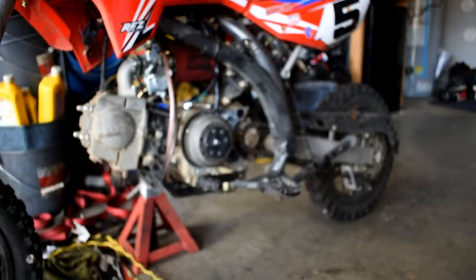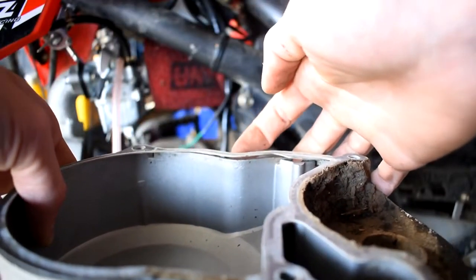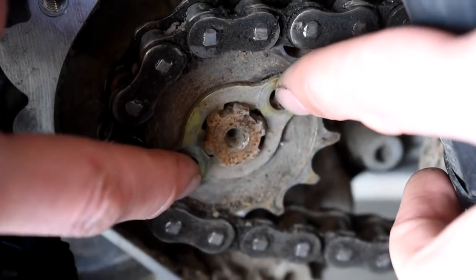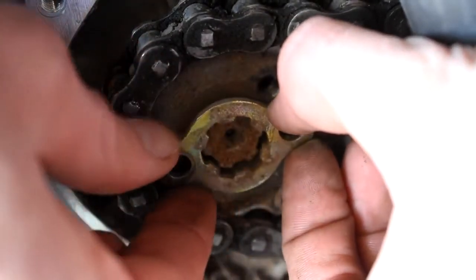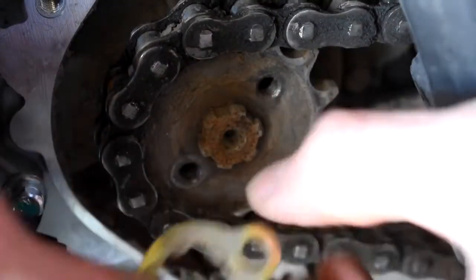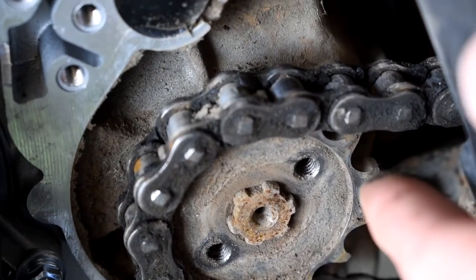The stator here, if we look right up here, there's that metal clip, that little metal tab, and that wants to get caught on it when you're trying to take it off, so just be really gentle. You guys can see when I go to move this little plate that the cogs go to where there's an opening, and then you can pop this guy off. As you turn it, it locks in place on that little cog so that guy doesn't pop off.